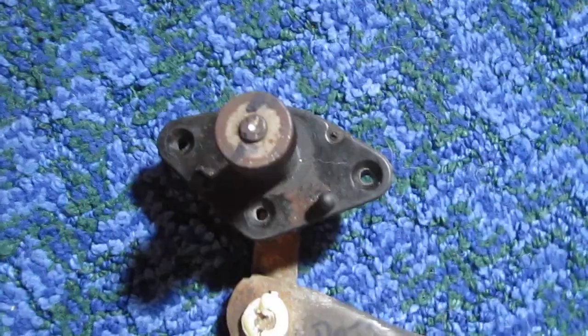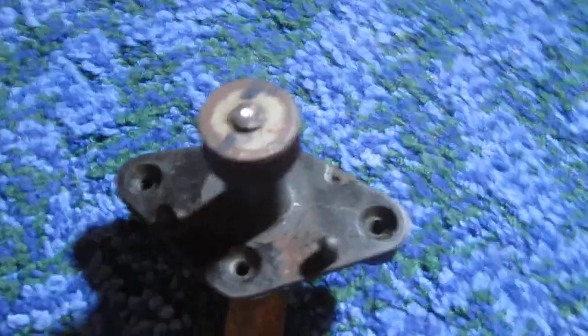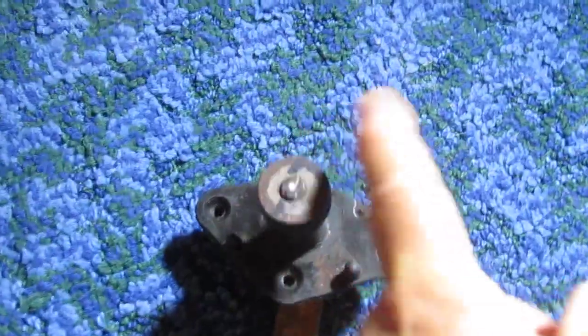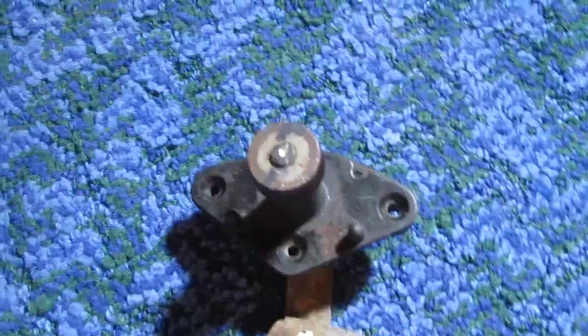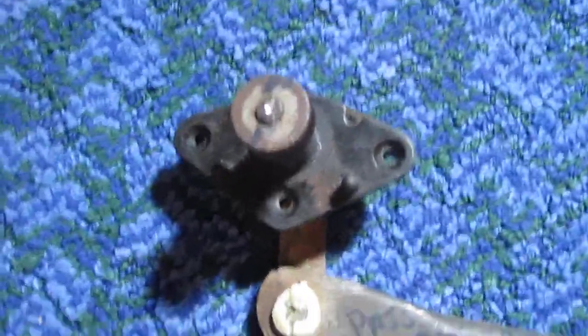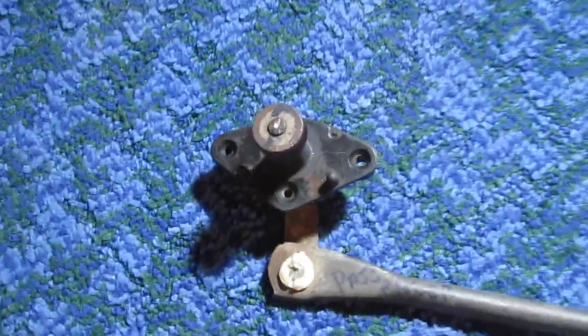Okay, as far as getting off the wiper arm, it's never been taken off, and it goes on this spline over here, and there's a pin that you need to open. Since it was so old, I had to use a screwdriver. If it was new, you probably can use your finger. And I used the crowbar, piece of wood, the whole arm comes out, but it wouldn't come out. WD-40 I tried to get from underneath, it wouldn't work.